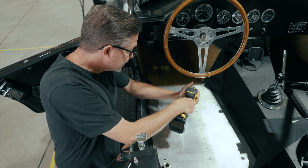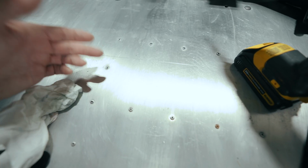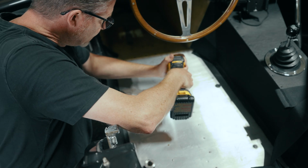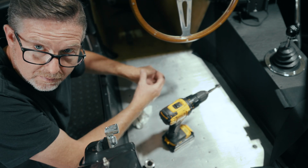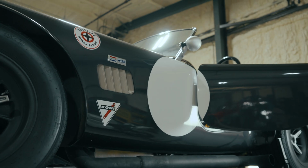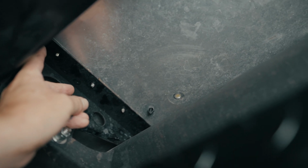So go ahead and break this through the floor so that that rivet falls out underneath. And then we can see what we're working with before I start enlarging the hole. So now that we can feel the rivet has popped out, we're gonna raise the vehicle up, get under it, make sure that we haven't caused any damage to the brake line. Okay, we can clearly see that we've come through the floor. Brake line's right here, so we're nice and clear of that.